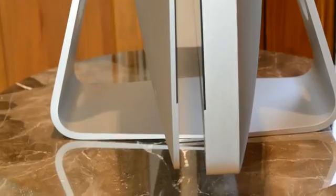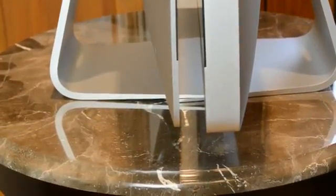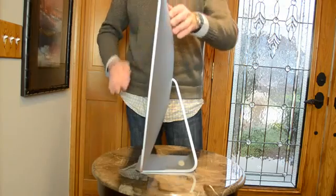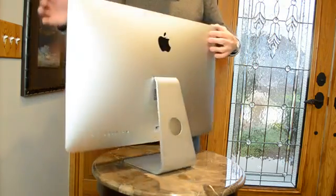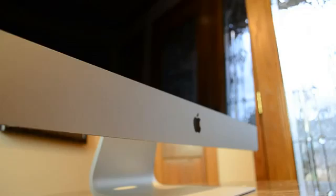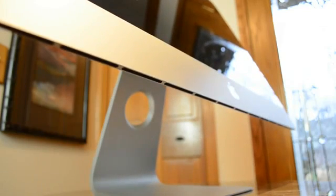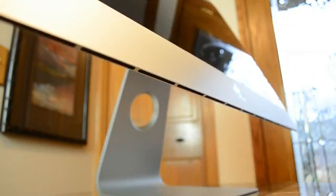So with the plastic removed, we can take a closer look, and the standout feature here is that 5-millimeter thin bezel, which gives us the illusion of an impossibly thin iMac. They've managed to achieve this by eliminating the optical drive, relocating the SD card slot to the back, and reducing the screen assembly's thickness by 40%, which involves laminating the LCD display directly to the glass. So unlike the previous iMac, you won't be able to easily remove the glass with suction cups. We still have that aluminum unibody design with a pivoting pedestal. The chin houses the Apple logo, air vents, and down-firing stereo speaker grills milled into the edge of the bezel. My initial impressions of the speakers are very positive — very deep bass response and a clearer dynamic range, using the chassis as its resonance chamber.